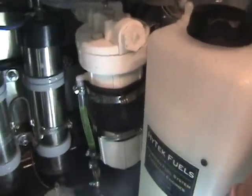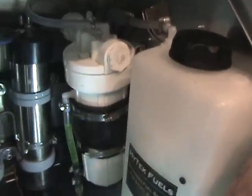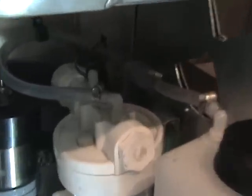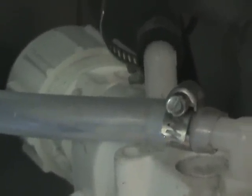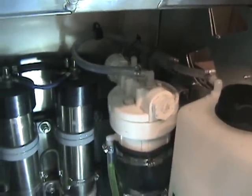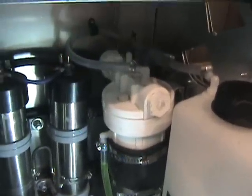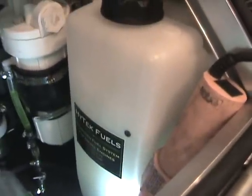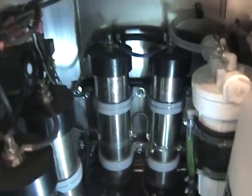Here in the back you see another tank. You're going to get some condensation in the hydrogen line, so we trap that condensation in this second bubbler tank. We also have an expansion valve back here, which is just a safety feature. In case there's any sort of backfire in the engine, that expansion valve opens up and allows any back pressure or explosion to escape there, so it can never get back to the cell. The second bubbler tank is full of fluid plus it has the expansion valve, and then you've got your main tank which is also full of fluid — so that keeps any kind of backfire, which is pretty rare in a diesel engine, from ever getting back to the cell.